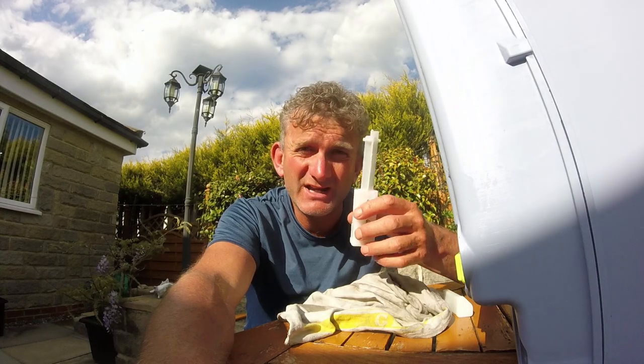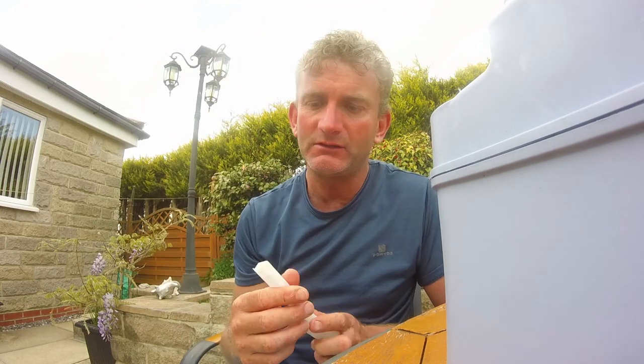This is proving to be quite a tough job because I don't want to break it and it's not going in as easily as I thought. It's in now. If you go on the caravan forums, a lot of people struggle with which way it goes — is the magnet up or down? They say the magnet should be down. This is flimsy plastic and to get it in there you've got to put some strain on it. It goes in with a click and a snap and you think you've broken it, but it went in. You've got to get it in at one angle, twist it, and up it'll slot in — make sure you lubricate it inside as well to avoid it binding.